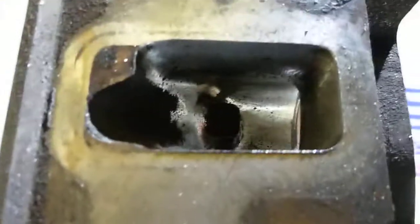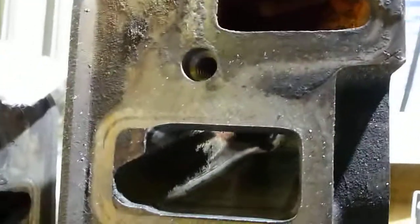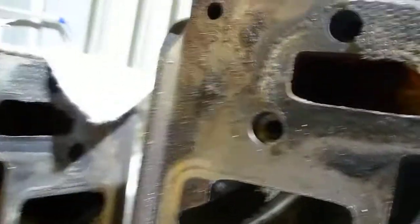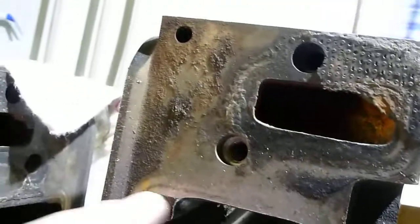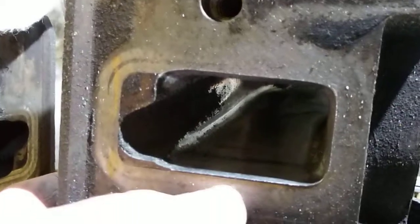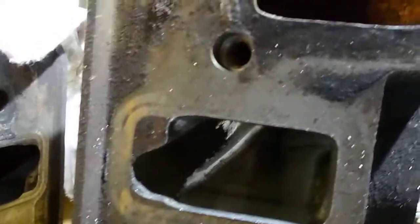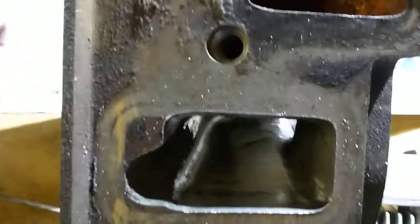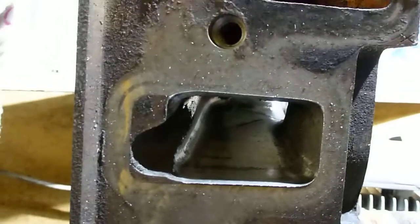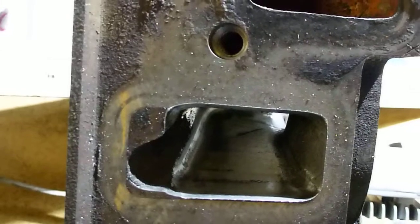I normally have the head sandblasted before I have a go at doing something like this. But with one respect, when they're greasy and dirty, I know a lot of people like to run the ruler along the edge, but you can see here where the gasket actually goes — so there's probably about another mill there to go down. But it gets to a point: how far do you go? If you set up a full set of drag racing heads, they're not so tractable on the street, so sometimes a little is better than too much.